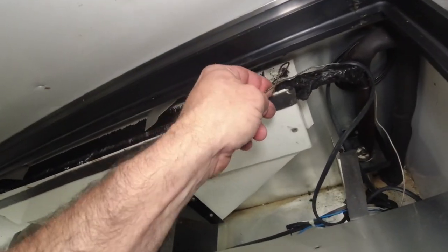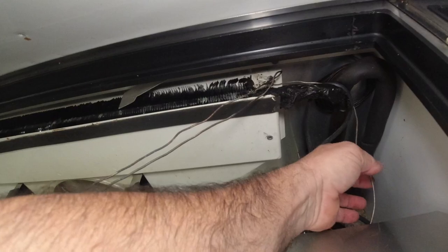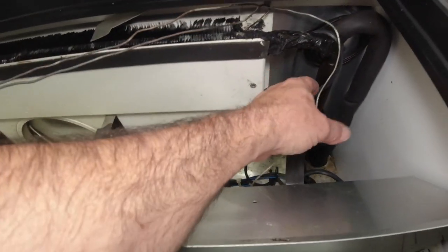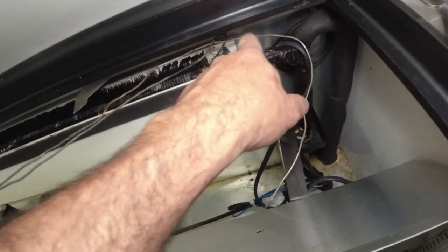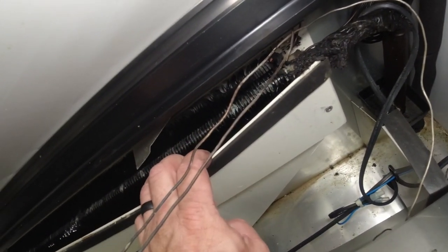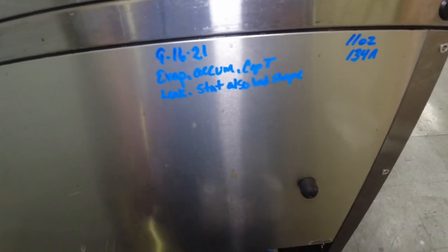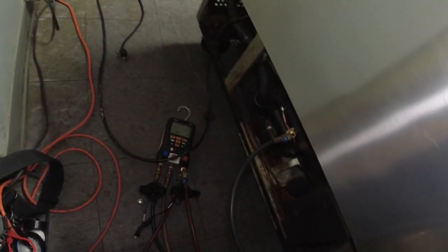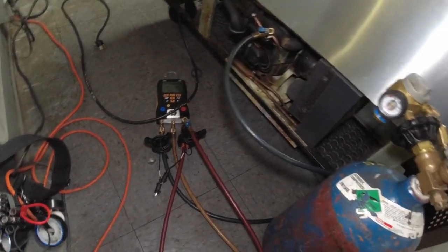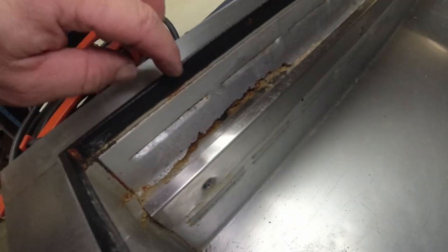This one's junk - we need a new evaporator. We'll also give them a new thermostat because this one has already been messed with - you can just tell it's all whacked out. We're leaking all up in here, so even if I fix the fittings, it's still leaking in the coil. We've noted today's date - the accumulator, evaporator, and cap tube are all leaking; thermostat is also in bad shape. This was just one of their extra units - it's really not worth putting a lot of money into if they're using another one anyway.